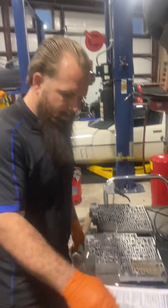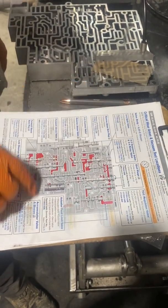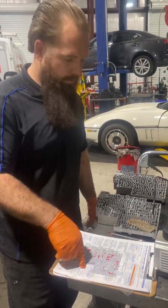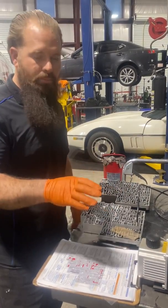So here's a little diagram here — it's kind of the Bible I go by. We're going to pay attention today to the actuator feed limit valve, an extremely important and overlooked valve in the valve body. The valve body controls everything in the transmission — basically the brain.